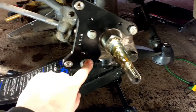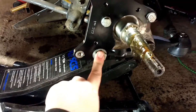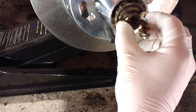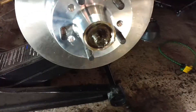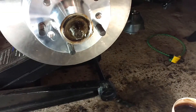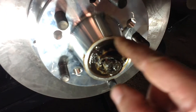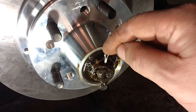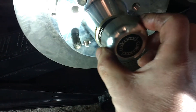These are the lower two bolts — the lower bolt is longer than the original on the other side, to allow for the plate, at 140 foot-pounds. I could use the old bearing, but I'm going to use the nice new bearing, packed with grease using the correct technique. We carefully put that in on to this, add a little extra grease, then use the original nut on here. Do that up, put the nut cover on with the tangs lined up with the hole so I can get my split pin through. Next is to screw on the Wilwood dust cap, which has an O-ring in it to make it seal.